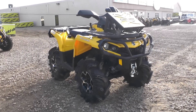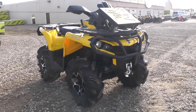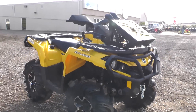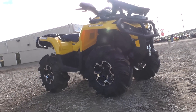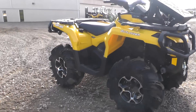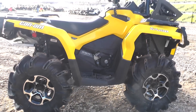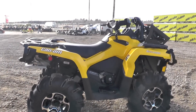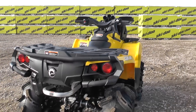A cool little project — 650cc Outlander Gen 2 chassis. We've got our 1 inch spring spacers on it, 1 inch spacer lift. 28 inch Silverbacks on stock rims, 1 inch wheel spacer on the back, and I have not trimmed the fenders on this unit. Another one out the door. Thank you guys, and stay tuned.